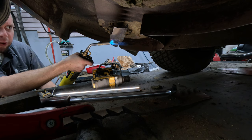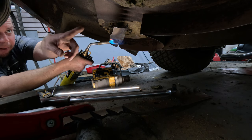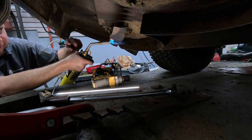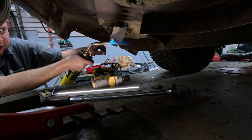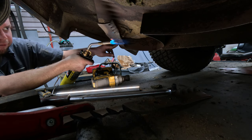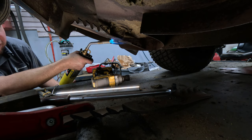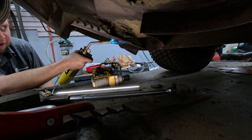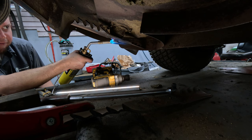You want to be careful when doing this. Obviously if there's a bunch of grass buildup up here and the flame is going to hit it on the back side, this stuff ignites extremely quickly — so be very careful and mindful of that. You don't want to start a fire under the deck. It usually goes out pretty quick, but it depends how much debris you actually have down there.